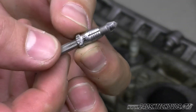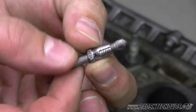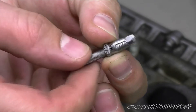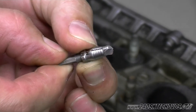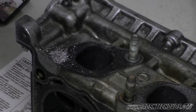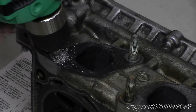After you get your hole drilled down enough, take your extractor out and you want to get the threaded part all the way down to the drill bit so it can start extracting the bolt out as you go down. You want to keep going slow — you don't want to burn your bit up, and you want to make sure you're drilling in the stud and not through the head.